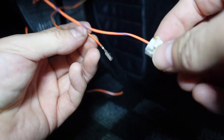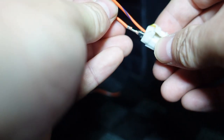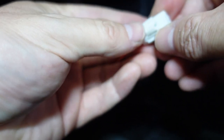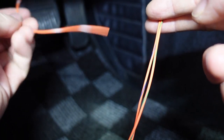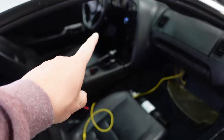Now I just need to slide the pin in — you can see there are two sides to this pin. I'll push it in this way and you can hear it click in. Now I'm going to tape up this wire, and this lock here needs to be pushed back down — boom, locked in again. I could have bought a new plug but I just repurposed this. I ran the wire up over the column, zip tied it, ran some tape over it. Now I've got to come over to the side, take off the cover from the Dual Designs ECU mount, pin one wire to the ECU, and run one to the ground setup — which goes directly to the battery ground.